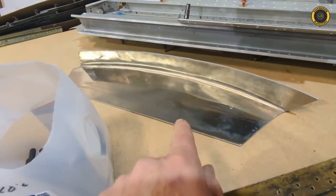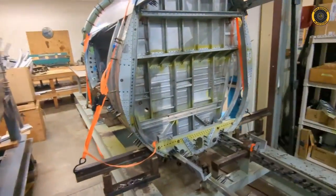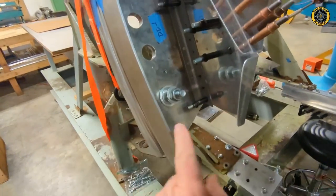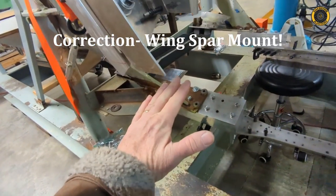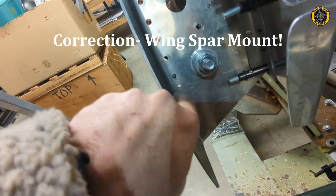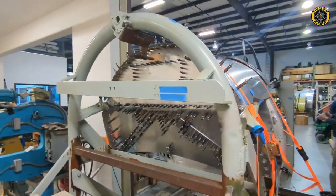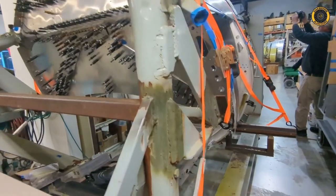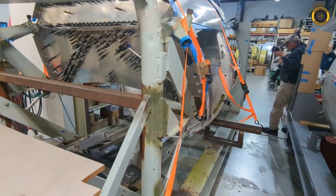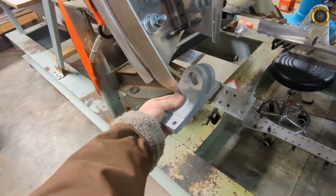Here's another one right here. Let me show you on the other airplane where this mounts exactly. Here's the fuselage of another Corsair — here's where this piece mounts, here's the engine mount bolt, and then the wing main spar attaches right here. So it's a critical, critical piece of the structure that was cracked right in here and replaced with a new piece, which is going to mount somewhere right in here.